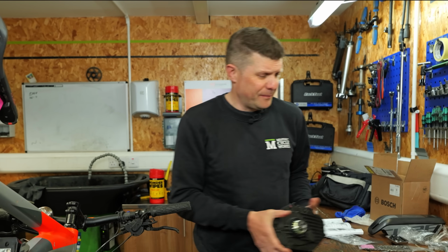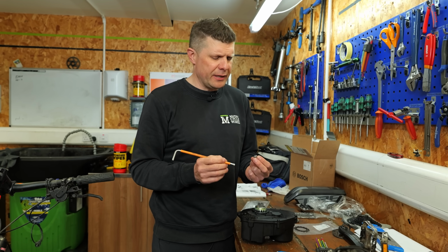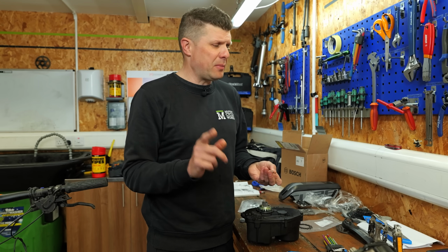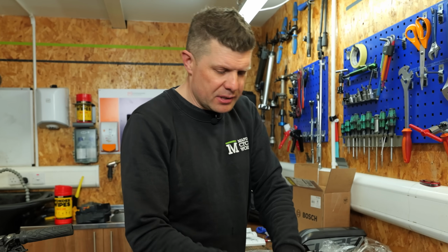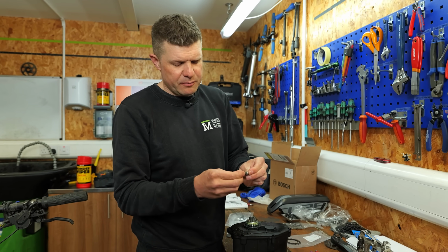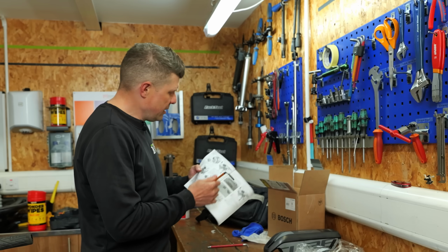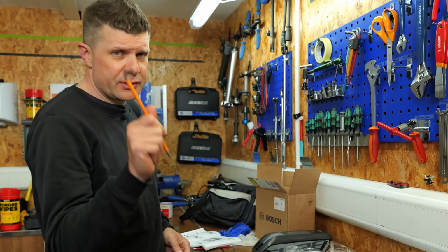Right, let's get started. Picking up a couple of points some of the more observant of you noticed from the last video we did on e-bikes: these bolts actually use a T30. Some e-bike motors use a Torx Plus, which looks like this, a slightly different shape, but this doesn't fit with these bolts at all. So look out for that. Some Bosch motors use Torx Plus. This one, even right here, Torx T30. So Torx T30 it is.